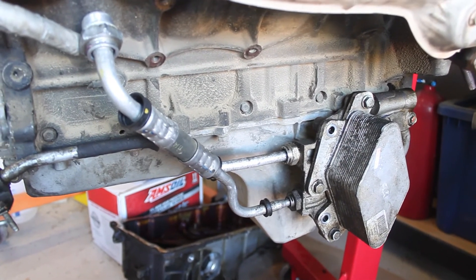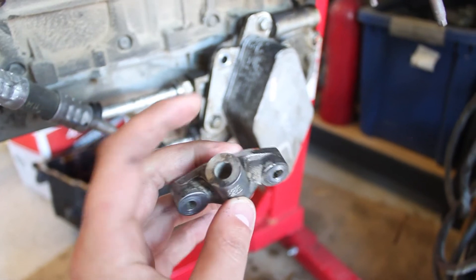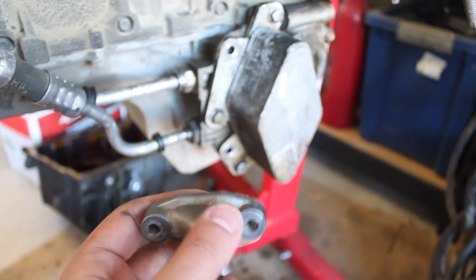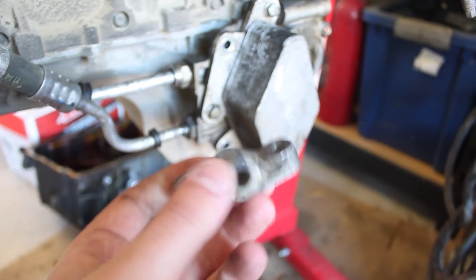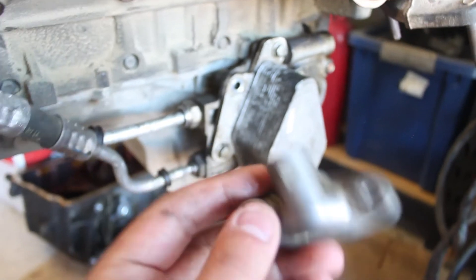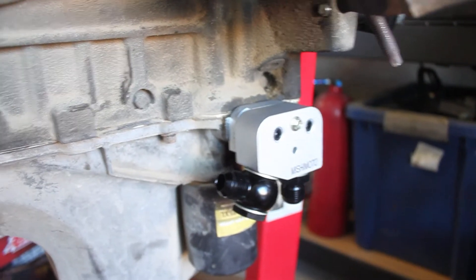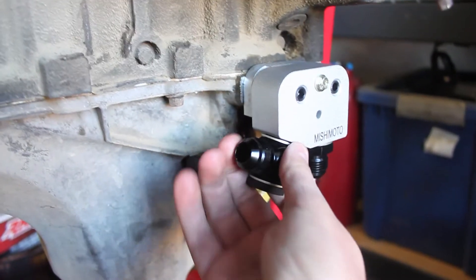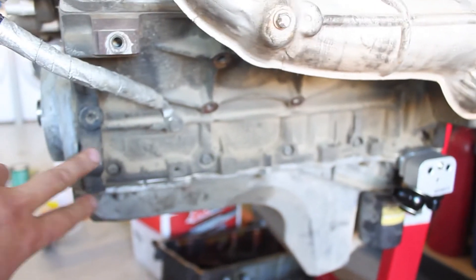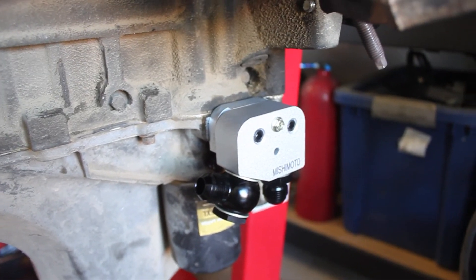I just don't think it works that well for road racing. So we took that off and in its place put a cap — the one we put on there doesn't have the pressure sensor port; I think ours has it up on the back of the engine. Now this right here is the Mishimoto block — it bolts in the same place the factory oil cooler came off, and these are dash-8 or dash-10 fittings. These lines will basically run up and go up to the oil cooler somewhere in the bumper. I don't know if we'll get that on before the race, but eventually this will be doing the oil cooling on the Caprice.